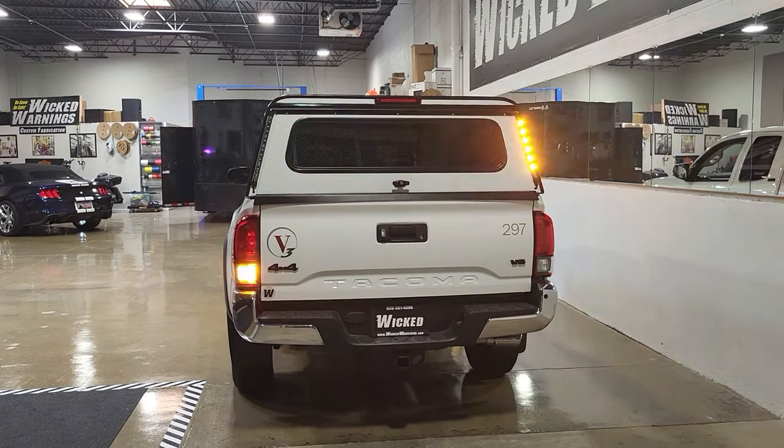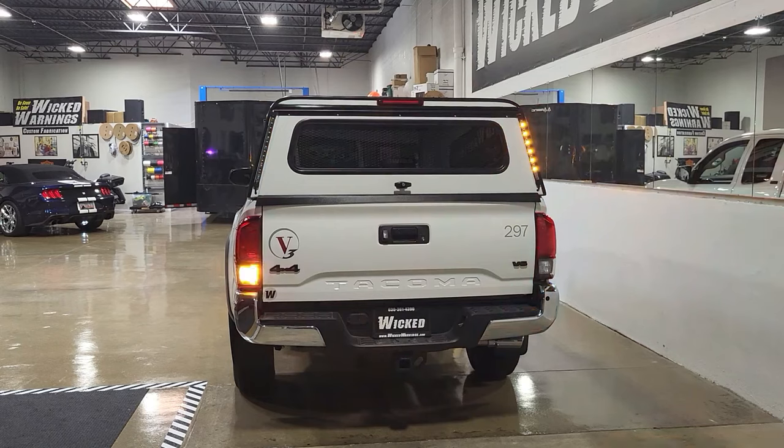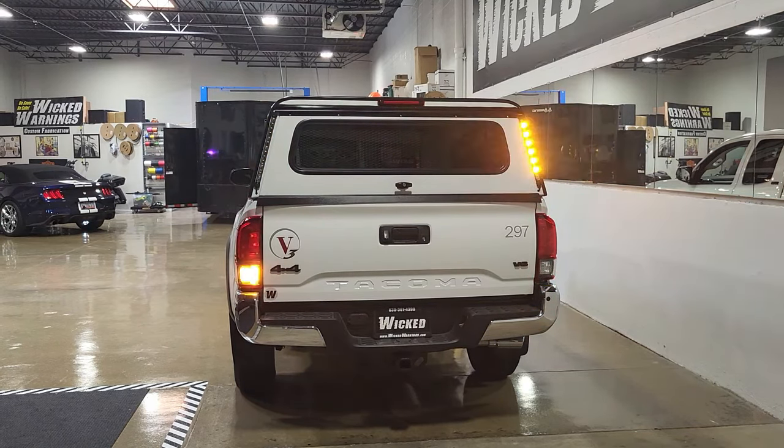Around the back, we'll give you that set of hideaway lights for the reverse — that's part of the truck package — plus 30 feet of 18-5. That extends the hideaway light module, which you'll probably mount behind the driver's side tail light, then run the 18-5 forward along the frame and up through the floor. You can drill a hole or use the rubber grommet near the driver's left foot area. The 18-5 comes forward to behind your switch where you set pattern, ignore synchronization and flood, then power and ground. I like to use the 16-2 ground straight to the battery and join all grounds at the switch, so power and ground converge solidly at the battery.